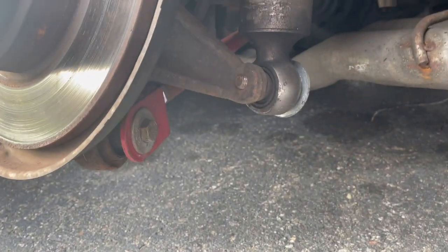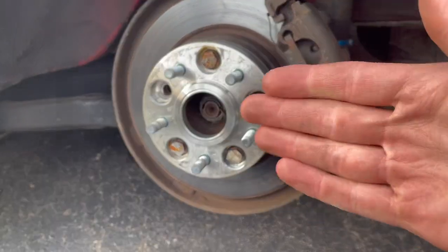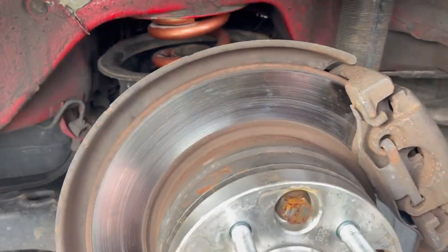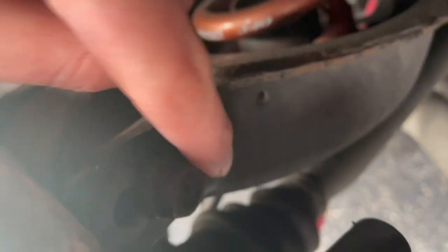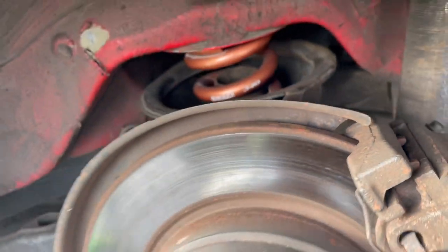One of the issues with the camber arms is that it pushes the hub out from the rear, so when you add camber it gives you a lot of toe-in. There are a couple ways to negate this toe. One is slotting the upper — here's the stock hole here and the other stock hole right there. You just get a half-inch drill bit, which is about $10, and you run it through behind where that bolt is so that you can push the top of the hub in further, which also helps fix the toe.